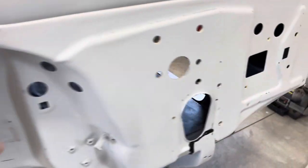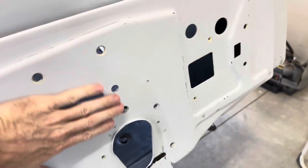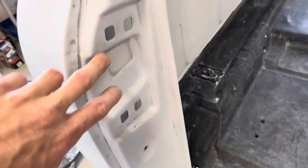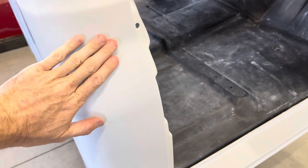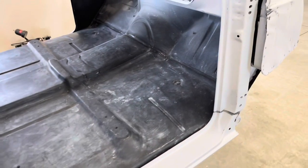I'm going to mask off all this area here too, just so as I'm spraying you don't have any contamination from inside out — kind of like what I did with the primer. All these areas that go inside to outside of the cab will be masked off as well, just so there isn't any contamination from the prep body outside, because this is a perfectly smooth surface and I do not want it contaminated.